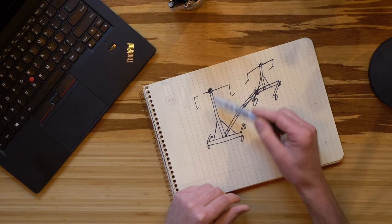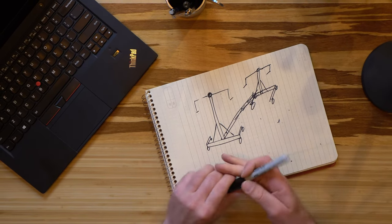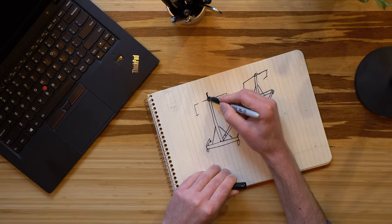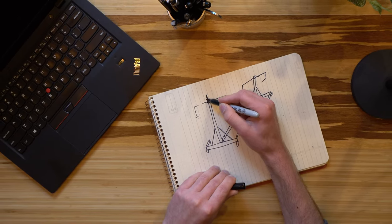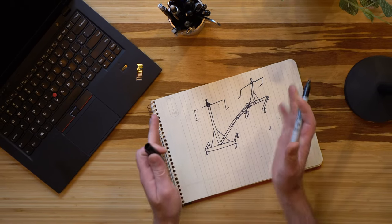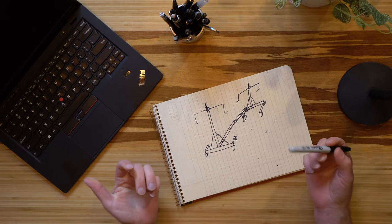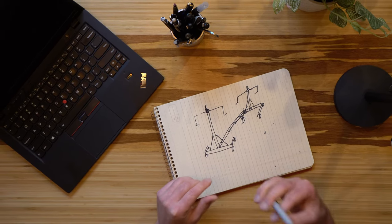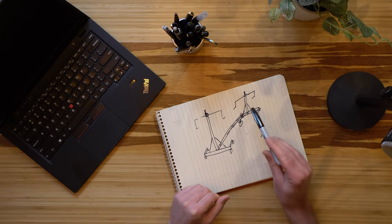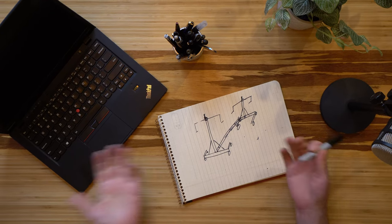And then as far as rotation locks go, all we do is just drill a hole through the outside piece of tube that bolts onto that upper T, and then weld a nut around the perimeter of that hole, and then thread a bolt through the nut, which then goes through the hole and clamps down onto the inner piece of pipe. So we have a couple of those per side, and that really just locks it in place nice. You just use a big old crescent wrench and tighten them down. I think I use like a half inch bolt on each one. They're pretty big. Anyway, that's the homebrew rotisserie, and follow at your discretion, but it's what we used and it worked out pretty well, actually.